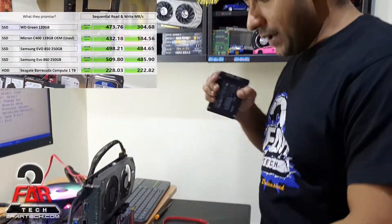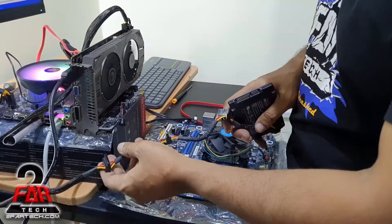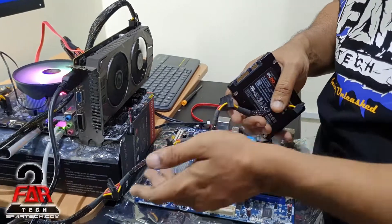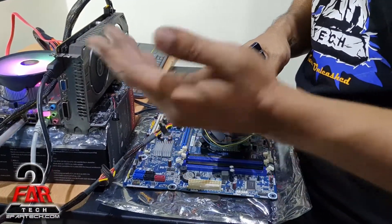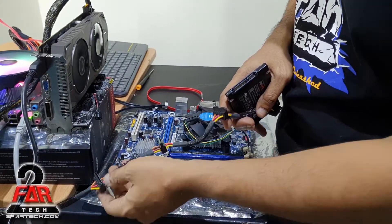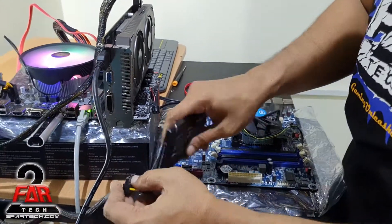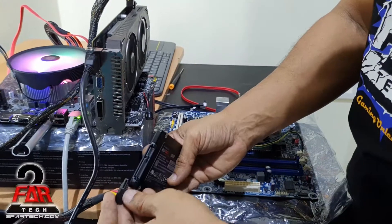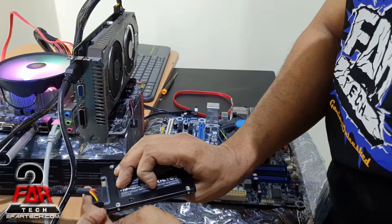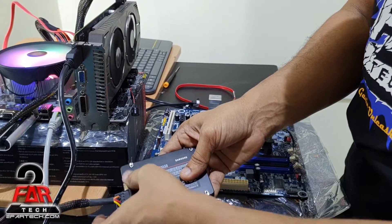Please make sure of the following things: always, if it is the boot hard drive or any hard drive, I always try to use the first SATA power connector. If it is a cheap power supply, there is a chance that over time these connectors might get damaged. Also, if you stretch or pull the cable, the joint connections could get damaged. So always use the first one, the closest one from the power supply. Make sure if there is no clip, you just plug it in the correct way. Please do not reverse install it and destroy the hard drive. Push it in and make sure it's fully inserted.